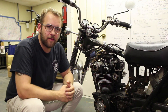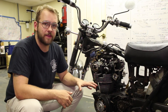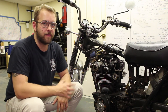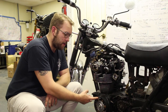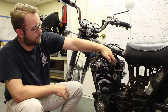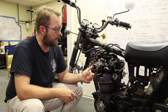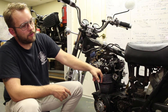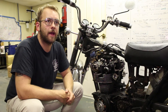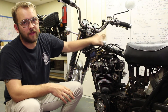This is a 1974 Honda CB450 that we're using on our long haul project, so a lot of the parts are off the engine already. To do this, you'll need to take off a couple of specific covers: the stator cover — be careful because some oil is going to drain out — both valve covers, the points cover, and remove the spark plugs. Not only so you can feel where the compression stroke is, but so you're not fighting against the compression when turning the engine over by hand. It also makes it a lot easier if you pull the tank off the bike.